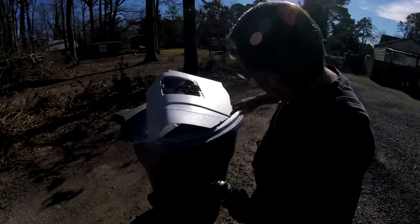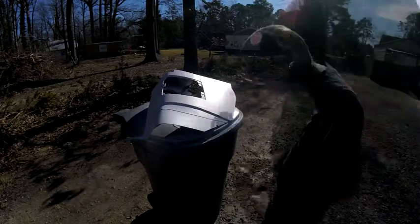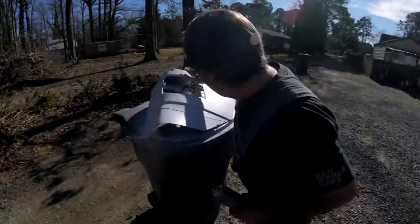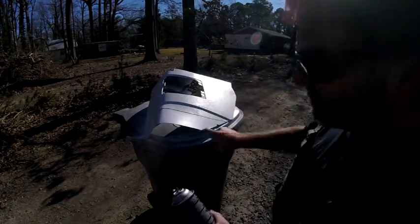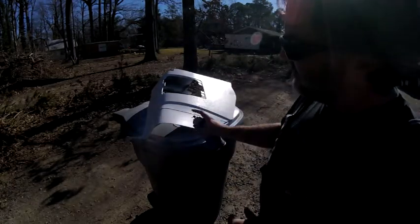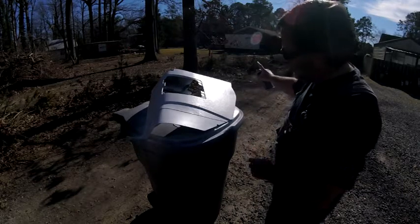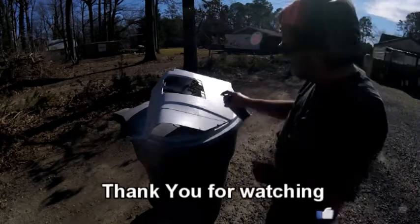And we're going to do this pattern this way across. Can you see that light reflecting? I think you can. See how that gloss was nice and even, and now that sheen looks exactly the same. And you see, I wasn't focusing on any corners or any edges. I was doing a smooth pattern all the way across the whole thing. If you noticed, I would start over here and start moving. When I got to the part, I put my paint on. When I go to stop, I take off the paint and keep moving. So it's like this: moving, on, off, stop moving, moving, on, off, stop moving.